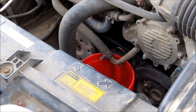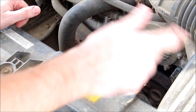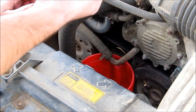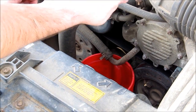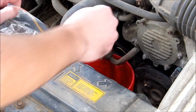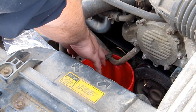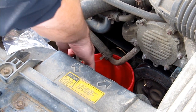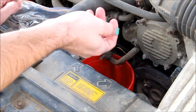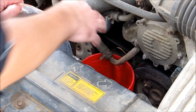Not many tools are required, but a lot of little things are going to be needed. This is going to be our sending hose. To keep from draining the rest of the system of coolant, I have these little very thick rubber bands that come off lobsters, but any rubber band will do in a Ziploc bag. So when I separate this pipe, I've got a clean container to catch the coolant that comes out because there's nothing wrong with the coolant. This will want to drain the system, but we'll just quickly place our Ziploc bag and a big elastic over the end to hopefully stop any leakage.